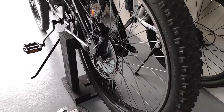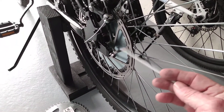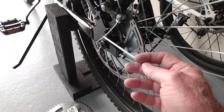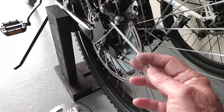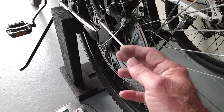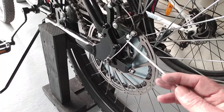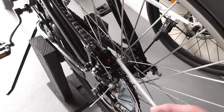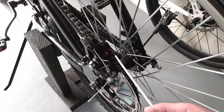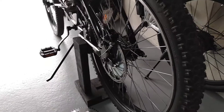The whole thing is less than a hundred dollars. I paid $39 for the SRAM Centerline rotor, $12 for the bracket, $10 for the post adapter, and a few dollars for nuts and bolts. You'll need those spacers off brake shoes — if you don't have them, just go buy cheap brake shoes. This caliper is off the front; I put a hydraulic up front so I had this stock caliper laying around. The whole thing is right at a hundred dollars give or take.